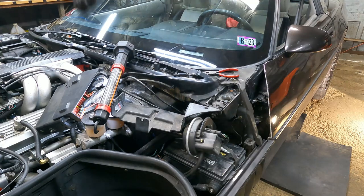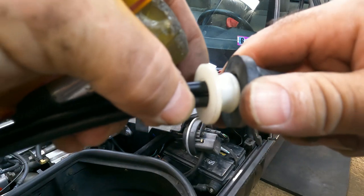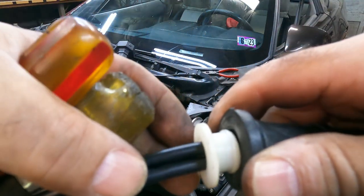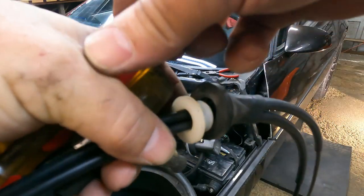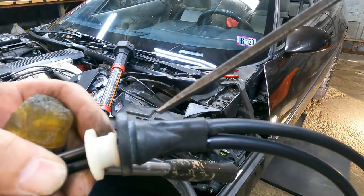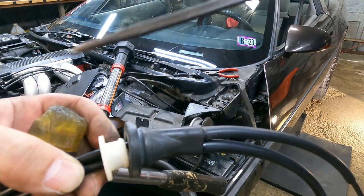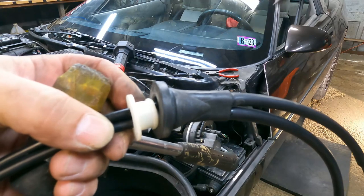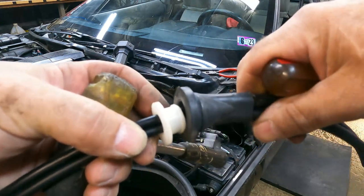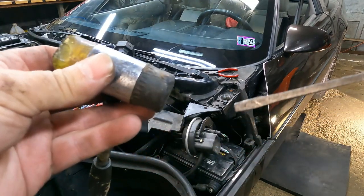I'm fighting this — this is the new cable. I ended up taking this plastic piece out, and I think this acts as a swedge and holds this rubber piece in. What I'm going to do is take a screwdriver, go right through the rubber boot down into this plastic piece, and push it back to see if that'll help unlock it. Then I'm going to go in there with a hammer and screwdriver and just pound it out.